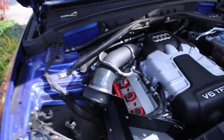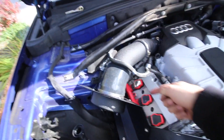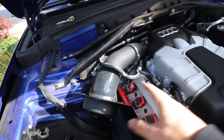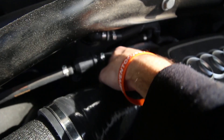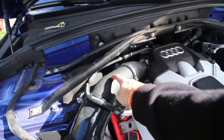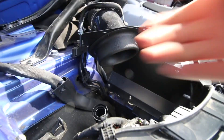Before I put everything back together, I want to give you an idea of what we're dealing with here. I did rotate this fuel line so that it would go underneath, but it was a little funky so I'm leaving it on top for now. I know people sell relocation kits — it shouldn't hit the hood or anything. One silicone piece goes here, we have the breather connected back here, then a hard piece here, and another silicone piece to connect it to the heat shield — which, if you know Integrated, also has an integrated velocity stack.